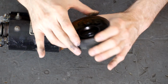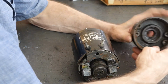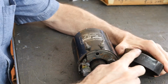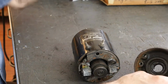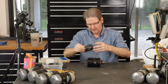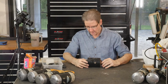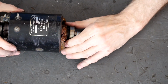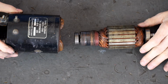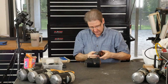But the interesting thing, the bolt holes are through holes, to grind this back. See, they've got a divot in it right here to help clear that engine case. How much you could grind back on an older motor, a pre-80, 81 and earlier, is hard to say. So there's a seal here, it needs to get popped out. We'll look at doing that. The armature should come out this way, right? Feel the bearings, they're pretty smooth. Armature comes out this way. Smell it. Doesn't smell burnt.